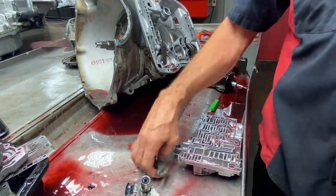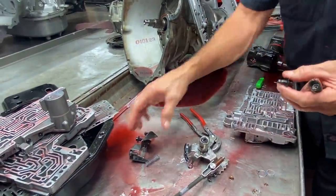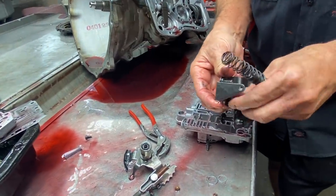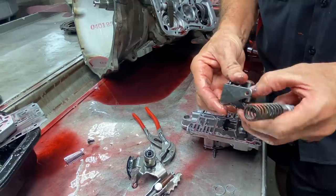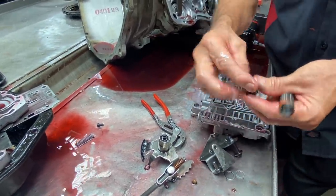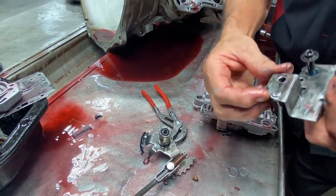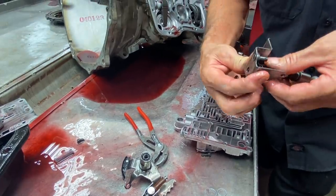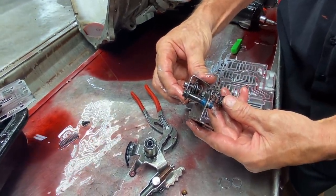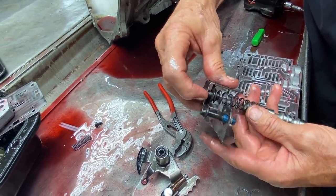And since I took these washers out, normally they want you to back this out until this is set and flush. Let me show you. They want this basically, and I tell you, you got to back this out where this washer is setting flush against this plate right here. If you put it in there right now from the factory, see, it's setting 1/4 inch away. See that? Well, they want you to back this out to where this plate touches this plate right here.